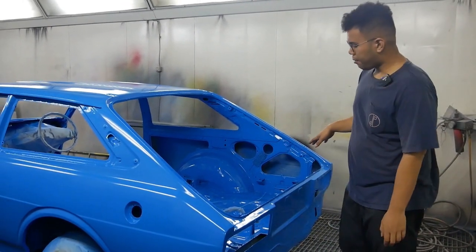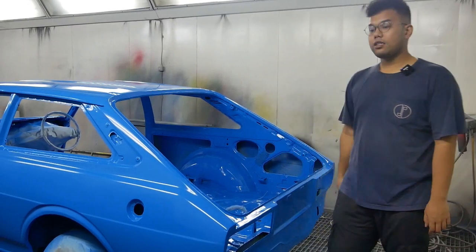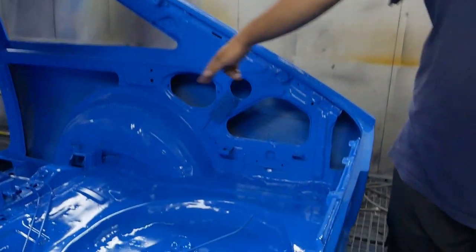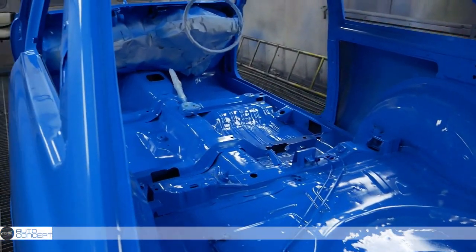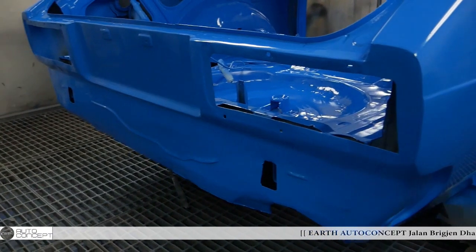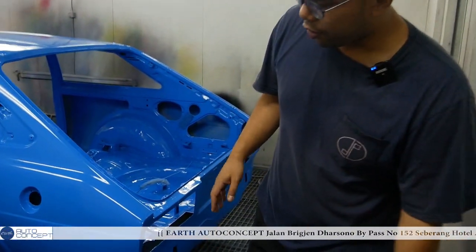If you check it under light you can see the shape clearly — if the bends aren't right it shows. We made it exactly like the original, all the folds and bends. This section was all made manually. We replaced the whole panel, and the front deck was also replaced matching all the original folds. The rear lamp mounts that were holed — we fixed all of those too. To the bone, that's the standard.